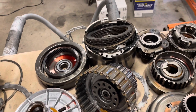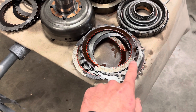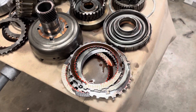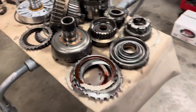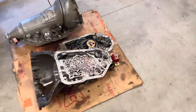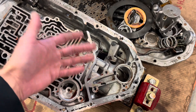Direct's not too bad. The whole reason I knew this transmission was toast is because of the low/reverse — look at that delamination. You've got clutch material all off here, all off there, same with this one. It's been hot spotted — it's just terrible. And the apply piston is blown out. So I'm not surprised; I knew about this because when I had the pan off you could see that section in the window right there, and I just had pieces of friction falling out into the pan.